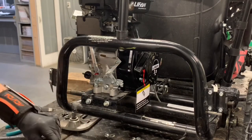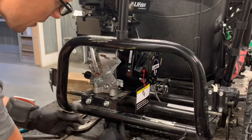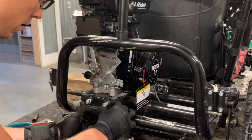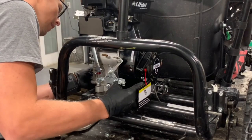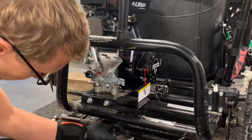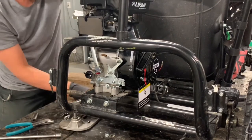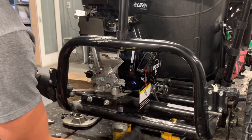10mm socket on the wrist. I'm going to slide this one up right now — go through here and put our nut on there. Before I do this, I'm going to install the front ones. You don't have to tighten these up yet because you will need to tighten that chain when we get to that point. The front bolts drop down from the top and then you've got the nuts that come in from the bottom. I'm just going to snug these up — not all the way yet until we get those chains on there.